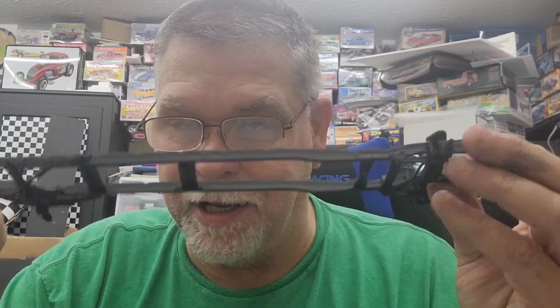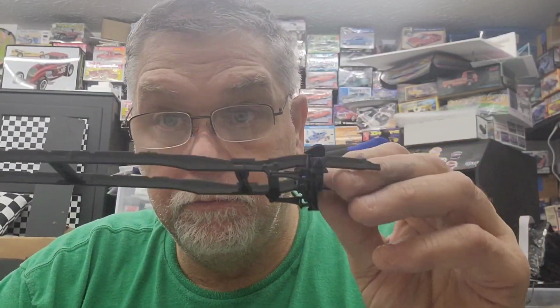It ain't going to go any further than that, because if you get it too soft, then the weight of the jar is going to stretch the plastic and conform to its shape. So don't get it too hot. But by doing that, and just let it sit there until it cools down, take the weights off, check it. Keep repeating it until you get that 3-wheel, 5-wheel motion gone. It will work. I did it on this, but I took the tires and wheels back off of it. The frame sits good now. So, that's proof in itself. Proof in the pudding, as people like to say.